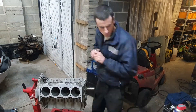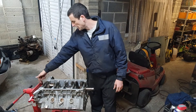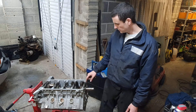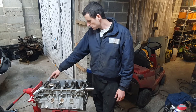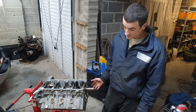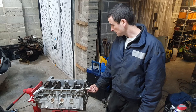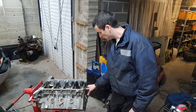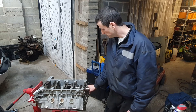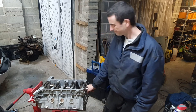The last main has the crucifix seal in it, so I've put a little extra sealant on there and tightened that down. Following the torque sequence from the manual, it looks like you tighten the mains first, then the side cross bolts, then back to the mains. That's the crankshaft now fully installed. All torqued down to spec: 58 Newton-metres, then 68 on the back ones, and 45 on the cross bolts. Does it turn? Yeah, she's sweet - turns by hand, just that thick oil slowing me down. That's perfect - great oil pressure with that tight tolerance. Job done.